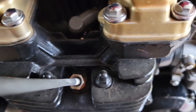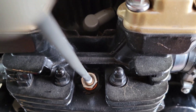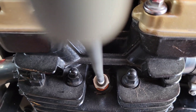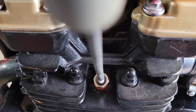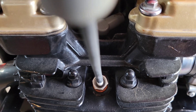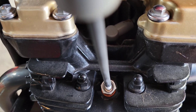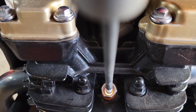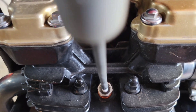I was having a little issue with number four so I moved over to number one, and it's slightly more blue. I think I need to readjust my carbs potentially. You'll see it go blue — look at that blue in there. That's what you're trying to achieve. It works, but a lot of the tuning still comes from you. It's just a good representation of which direction you need to go instead of guessing all the time.